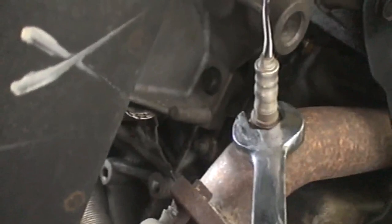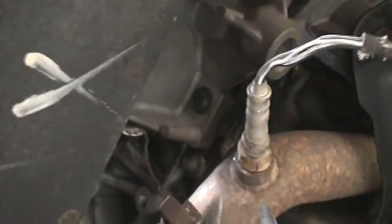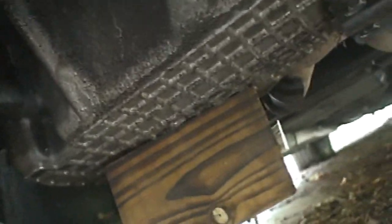I'm trying to hold the camera because I can't get a tripod underneath this car. I'm on my jack here, and I've got this scissor jack. Since you're pulling this motor mount off, if you don't have something under here, this engine's going to twist on you, and it could hurt you. So if you can, put the car on jack stands, get you a good jack underneath the engine there. Always use a piece of wood because that's aluminum and a jack steel will slide real easy.